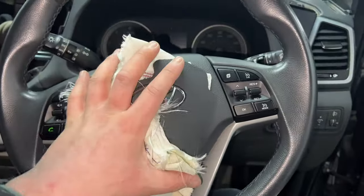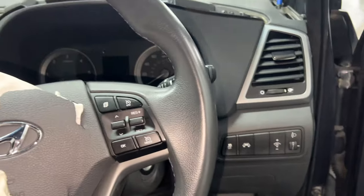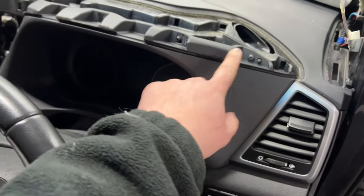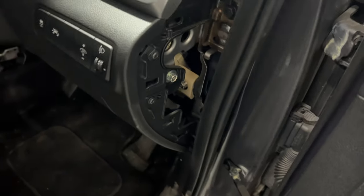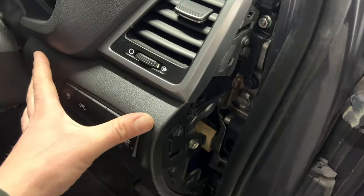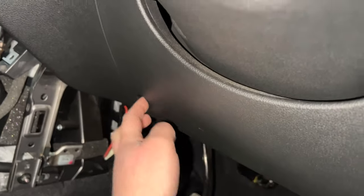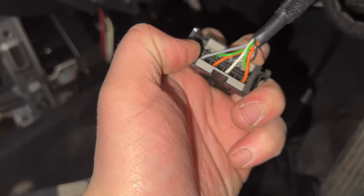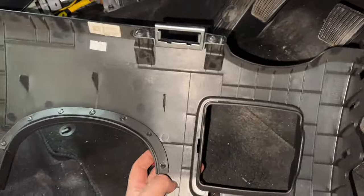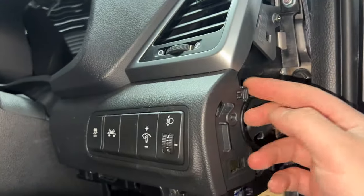Then it'll be onto the steering wheel, the clocks, all the lower trims and the buttons, then the glove box and it'll be ready to come out. For the speedo, remove these two Phillips screws on the top, one either side. Remove the door rubber out of the way so you can take this end piece off, because you need to undo these two Phillips screws to remove this piece — there's a bolt underneath. For the lower trim, you've got a Phillips screw here and one more just here. For the OBD port, there are two plastic tabs — squeeze in either side and it will remove from the lower trim. Once the lower trim is removed, it exposes two more Phillips screws, then that will just pull away.